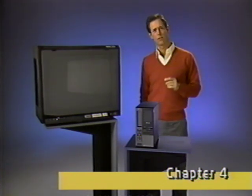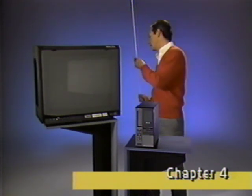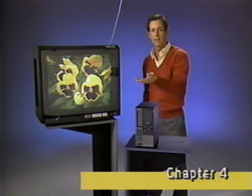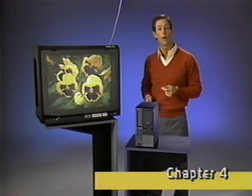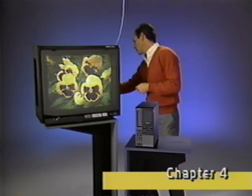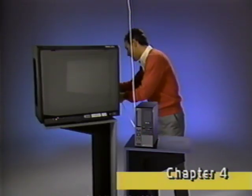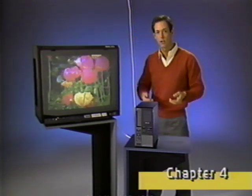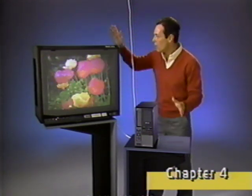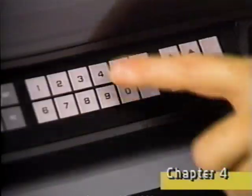To understand how this works, think of the TV signal as water flowing through a garden hose. The signal flows in from the antenna and into the back of the TV, then flows out again as a picture. Your new VCR also has a tuner built in, so in a way it's like a TV set, only without the screen. The signal flows in directly into the back of the VCR, then flows out again directly into the TV. The VCR's tuner works independent of the TV's tuner, which means you can change from the TV's tuner to the VCR's tuner or back again anytime you want. Having two independent tuners is why it's possible to record a program on one channel while watching a different program on a second channel.